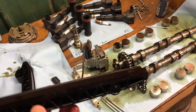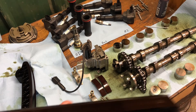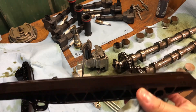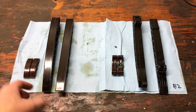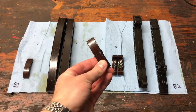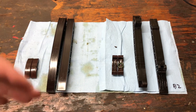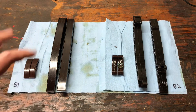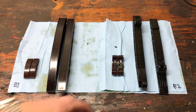I mean, looking at this VarioCam pad, obviously it is wearing and needs to be done. But I was like, man, that's all the wear that's on those. But you know, this is clearly some wear and so these need to be replaced. I've decided to kind of skip ahead, not so chronologically, and go ahead and show everyone what the Bank 2 timing chain guides looked like. Now at this point in the video, I just showed you what all of the Bank 1 timing chain guides looked like — I showed you that on the top VarioCam solenoid pad there was some pitting. And as I also said, I was going to do the banks in series. So the engine is actually already together at this point and it's actually back in the car. We're skipping ahead, and I just want to be able to show you all of them in the same video.